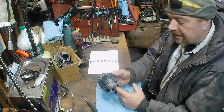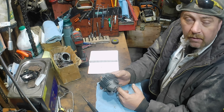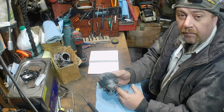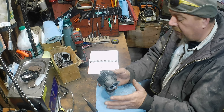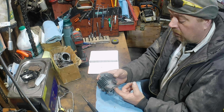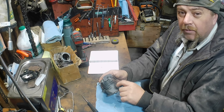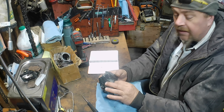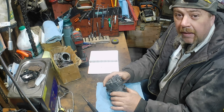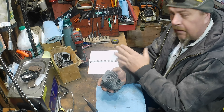Instead of compressing for 99 degrees of rotation, I was only compressing for 93 degrees. After I cut the base, I wound up right at 99 again - which was stock exhaust timing. With the aftermarket cylinder and base gasket we were actually at 63 degrees intake timing, which to me is way not enough. That's 126 degrees of rotation - I want to be at 150 to 152, so that's 24 to 26 degrees of total opening off of where I want to start.